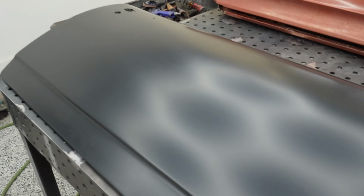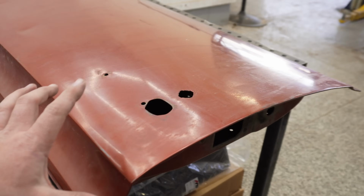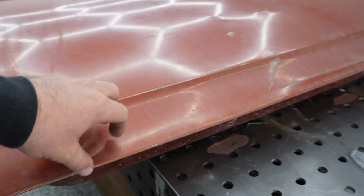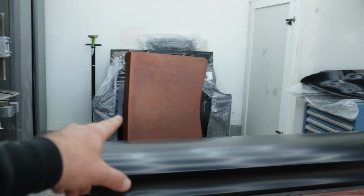But the good thing is our friends at AMD actually make every single part and piece for this car. So what we have here is a beautiful, fresh passenger side door skin. And the process for installing this is actually quite simple, and I'm going to show you guys over the next few minutes as we grind away this original edge, peel off the door skin, knock off all the original spot welds on the other side, and then prepare and install that door skin.